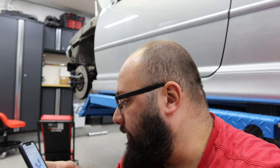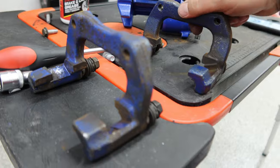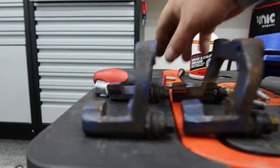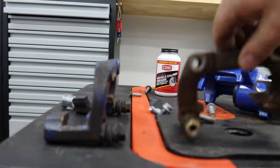These caliper carriers work on both left and right side — same item number. The calipers are not, though; the calipers are left-right specific. As I pointed out, this caliper has a little wear right here, and when I put it on my new rotors it was touching the actual rotor. So I'm not going to put something on that's not right. Looking at the angle here, this one has just a little bend and then up, while this one is completely bent — and it's actually a different part number. These things are a whopping $200 a piece, so I am not going to do that.